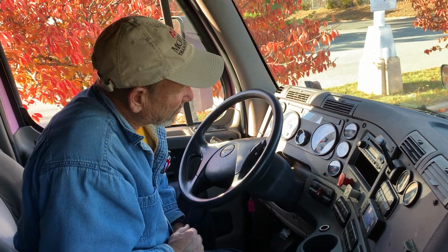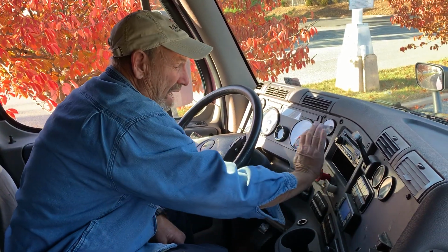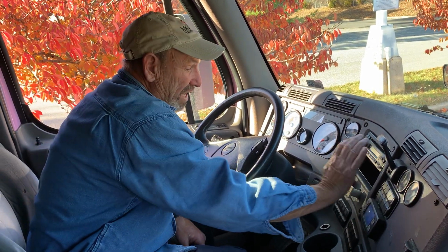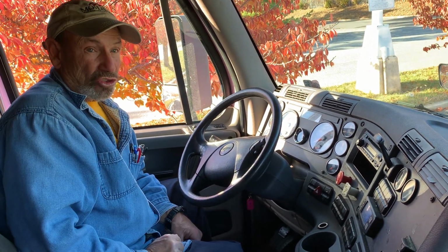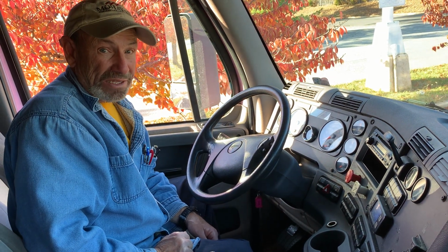Okay. Another common mistake is, like I said, when I push them with my 2 palm hands, some students only get 1 in, or they use their fingers and 1 stays out. And then when they do the final test, the tractor protection valve operation check, when they fan down to about 30 psi, nothing happens.